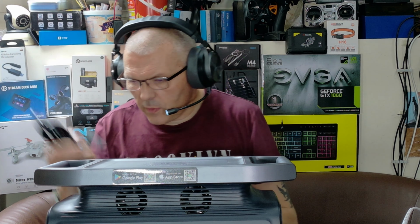What have I used this one for then? So I've tested it out on the UPS on my computer. Now the other one, the 550, wouldn't really work with my computer. It would work, but when I used my game, like a normal computer, just using it for content, it uses about 300, 400 watts, 500 watts max. But if I play a game like Flight Sim, something which is demanding on the graphics card, it can shoot up to 800, 900, 1100 watts.